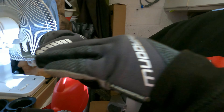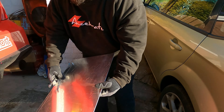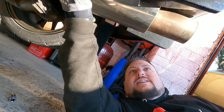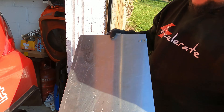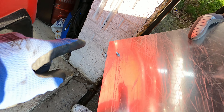When we say cutting a groove - we should explain: the idea is to undo the bolt from the anti-roll bar and then slide the bracket up as much as we want, so we've got adjustability as well. We'll show you when it's properly on the car. So this is what we're trying to explain - the grooves in the brackets. Back those bolts off a little bit... and look at that - it slides! Just tighten them up. This is the final prototype - we've mocked it up and it seems like it's going to work.